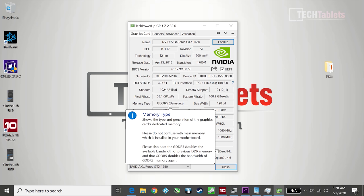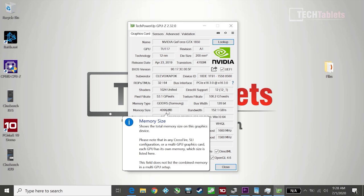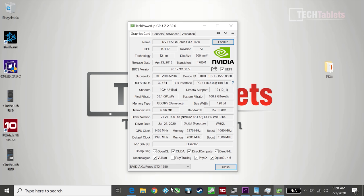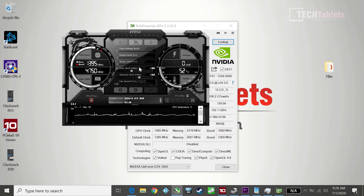The GPU has Samsung RAM, which in my experience overclocks better than Hynix RAM, giving a nice bandwidth boost. The GTX 1650 has 4GB of GDDR5. Using MSI Afterburner, I have overclocked the GPU — adding 750MHz to the memory clock. The core clock overclock gives about an 8% boost on the graphics core score with no real temperature increase.